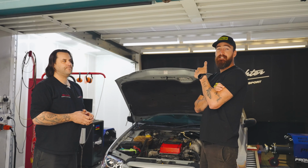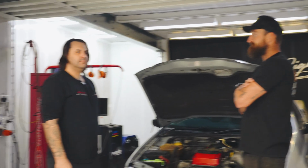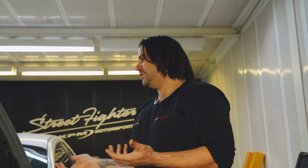Well, now's the exciting bit. We're going to be running on the dyno, see what numbers we can get, and have a play. That's it. Let's do it. Finish her up. I have to have a guess. I've got to see what this turbo is going to be able to do. That's the big thing: how quick it's going to spool up, where it's going to hold, obviously with the wastegate setup that's on it, because it's running the factory exhaust housing with the larger gate on it. We'll just see what it ends up at.